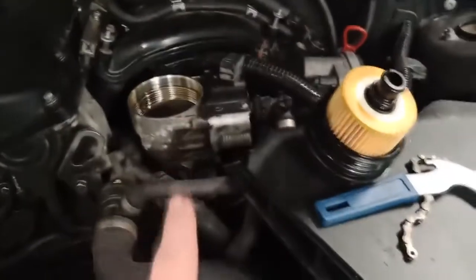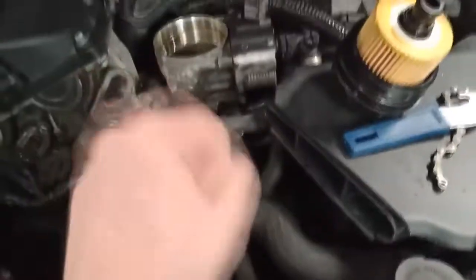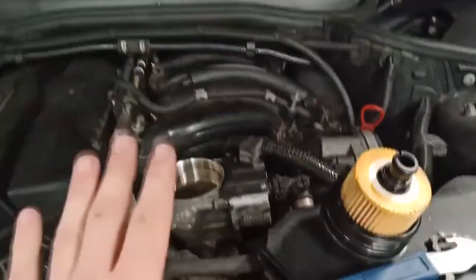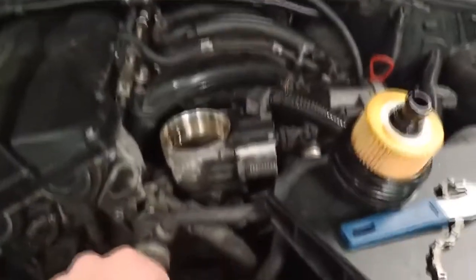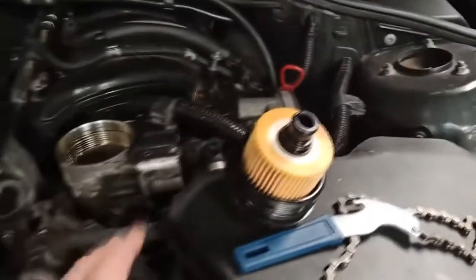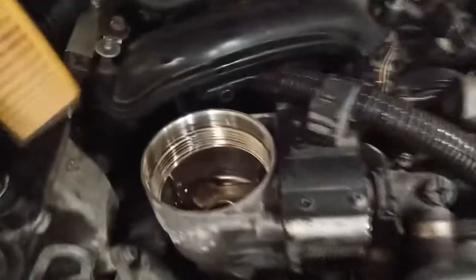Now, my standing camera just died, and I did the oil sump plug. Just tighten it until it's tight, and then give it a quarter of a turn, and that's it, leave it. If it leaks oil, then you can just lift the car up again and tighten it some more until it stops leaking. Now let's screw this one in.